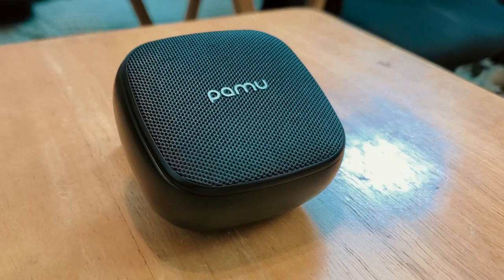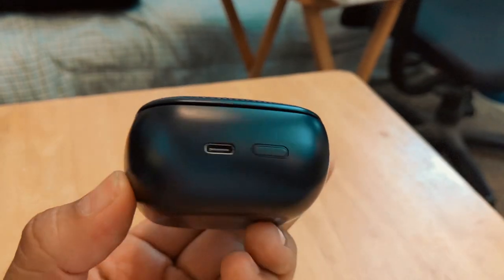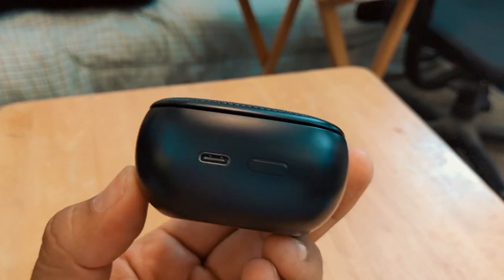So let's talk about the case and the battery life. The case itself is a bit on the bulkier side as far as true wireless earbud cases go, but it needs to be for all the functionality built into it. Firstly, it's got a 2000 milliamp hour battery, so you've got plenty of battery to recharge these earbuds. That's a big battery for an earbuds case. It's also USB Type-C to recharge the case itself — welcome to 2019. It will charge fairly quickly on a fast charger. As far as the earbuds themselves, you can drop them in the case and they have a fast recharge feature — five minutes in the case gives you one hour of playback time.